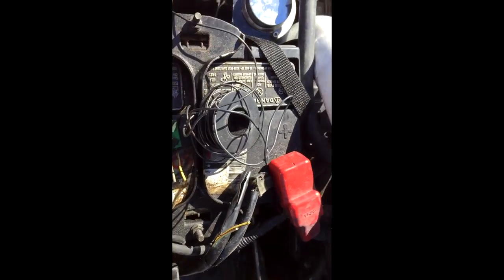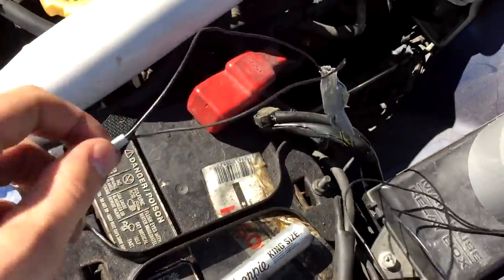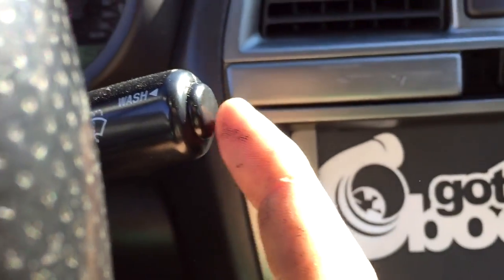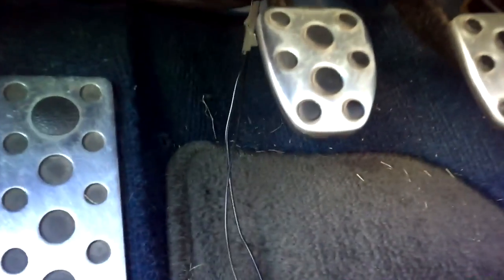Next up is wiring — you're going to cut the green cable. Give yourself about two inches of play from the green cable where you cut, so that you can strip it and rewire it. Once you have the wires wired into your original harness, get the connector you cut off and make sure you set the polarities up right — ground to ground, hot to hot — and rewire them. Now you'll have a 12-foot-long wire with the green connector at one end and your harness all the way back in your engine bay. Feed the green connector through your firewall, and if you want, use electrical tape or duct tape every six or seven inches to tape the wires together.